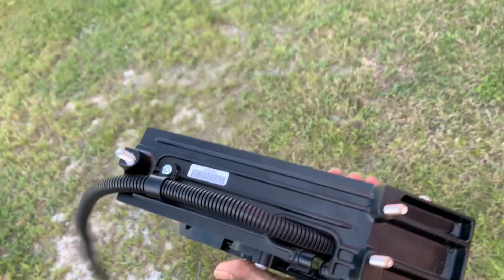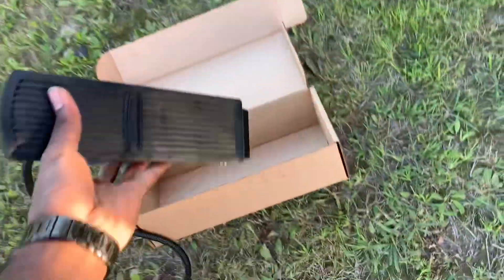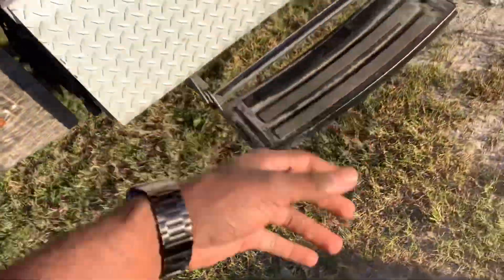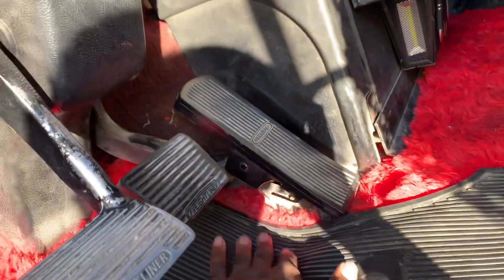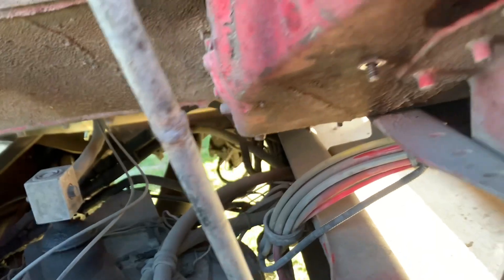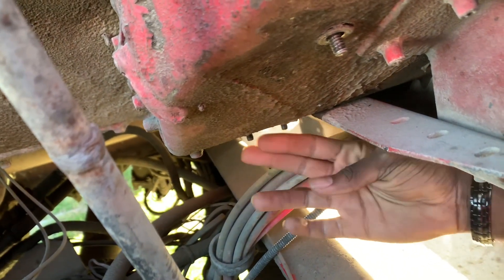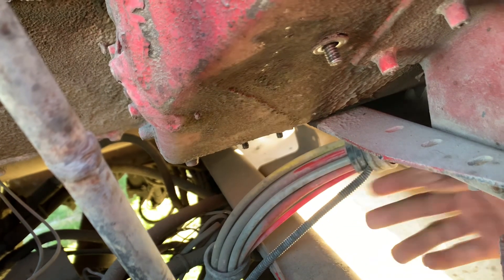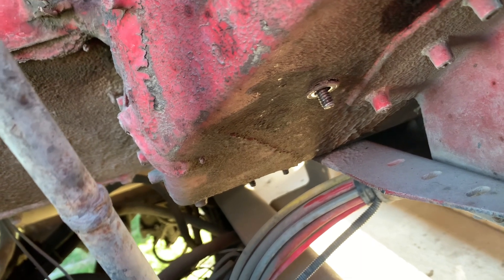The way these are set up, they already come with the screws already in them, so that means you have to unbolt this from under the cab of the truck. Let me show you guys the inside first - that's the throttle right there. There's no way to get under this throttle, so you have to go under the cab. You have a bolt right here which I already took off, and then two more on the right side. It's these three bolts - you take them off and then you're able to pull the actual pedal out, disconnect the cable, put everything back together and you should be good to go.